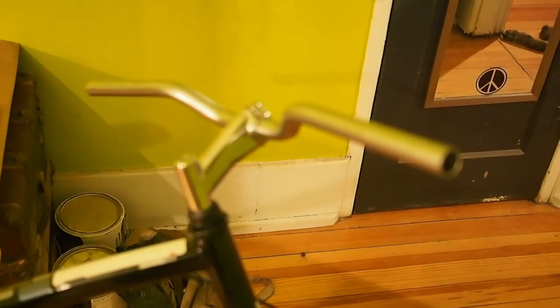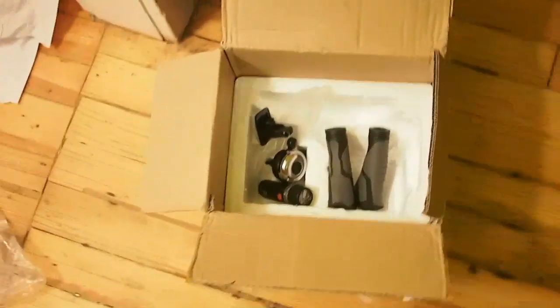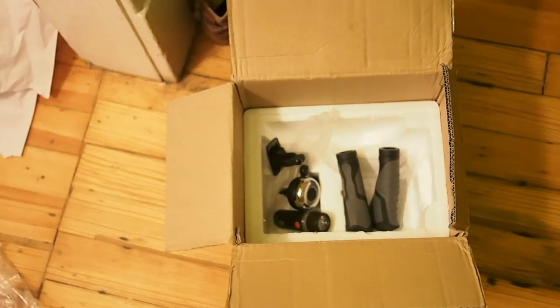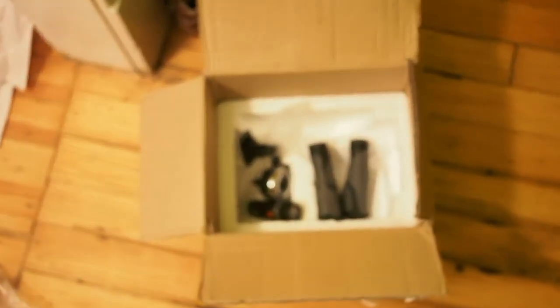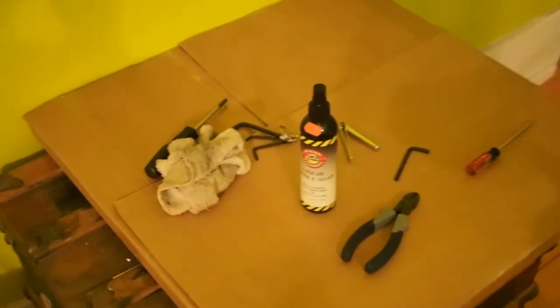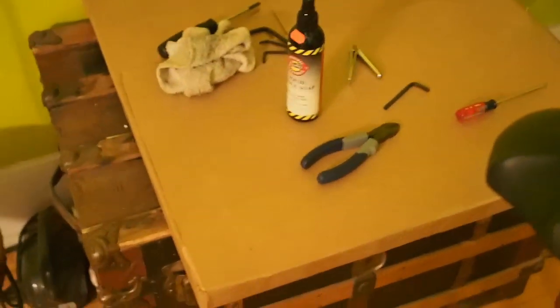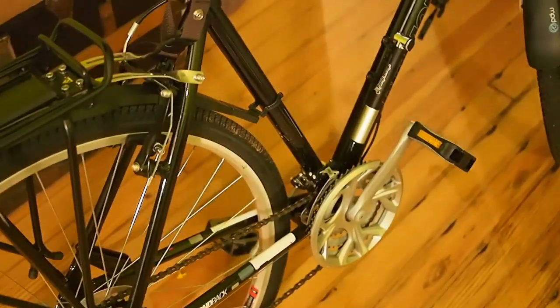As you can see, we've got all the accoutrements off the handlebars. All the shifters are hanging there — most of them are going away. The only cable being reused is the front brake cable; all the other cables are in the dumpster. The handle grips came off in one piece by sneaking a screwdriver in from the handlebar side, using soapy water — I used saddle soap, which works fine and doesn't mess up the grips. The same soapy water is what you'll use to put them back on. The next step is to pull off the front derailleur and all the crank mechanism.